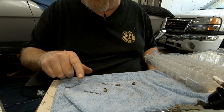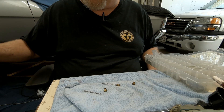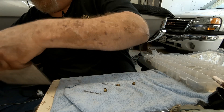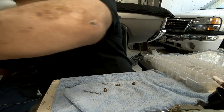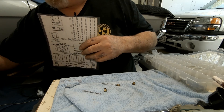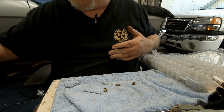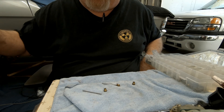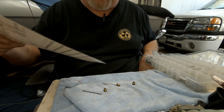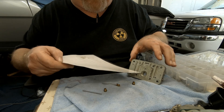I really suggest buying this drill blank set if you're tuning Holley carburetors. I bought it on Amazon — it's an M1 190-piece drill blank set, goes from .061 all the way up to .250. I bought it strictly for this reason, but you can use it on nitrous jets or anything that needs to be measured.